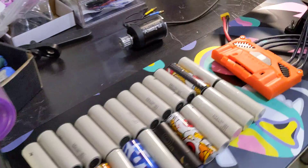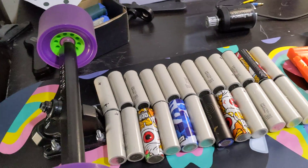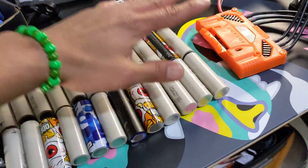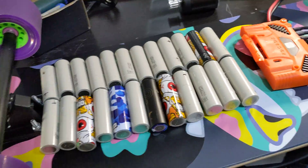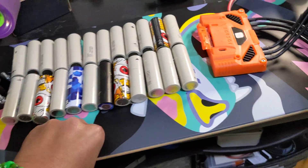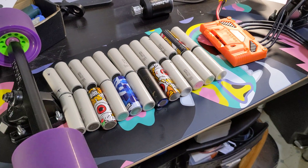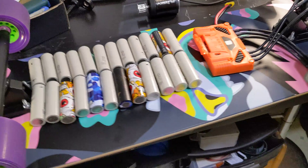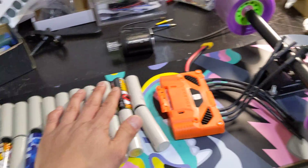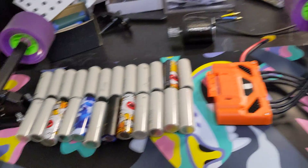As far as the battery pack, I'm not going to build it into the case. The problem is if you build it into the case like a lot of boards like Ownboard, if it's got a BMS problem then you have to take apart the whole damn battery. By having the battery pack separate and just a pack inside the box, if you have battery problems you can just swap out the battery pack. This board is not really a flex board and with pretty good wheels I don't care about flex so much. I can just build a battery pack separately and see how the Focbox does - it's gonna be my first time using it. Let me build it, have a great day, I'll have part two soon.